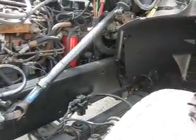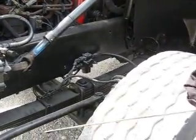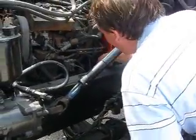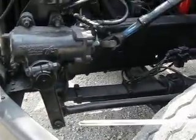I'm going to pull that out. That's been running for a little bit. You can see that the oil's nice and clean for a diesel motor. I'm going to go ahead and wipe that off and show you the level. And with the sun on it there, I believe you can see where the oil stops. You can also see it's nice and clear looking, showing the signs and the evidence of just being replaced.